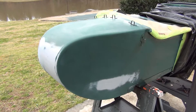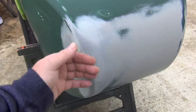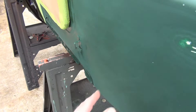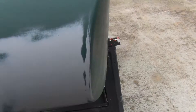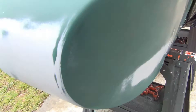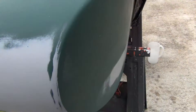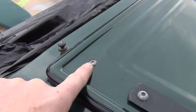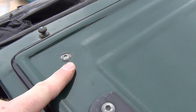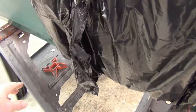We're working on painting up the sidecar — the dent has been repaired, it's all primed and ready to go. We've smoothed out a few other areas. This is not a perfect preparation; we've wet sanded it down to 400 grit. I'll wipe it down with denatured alcohol just before we paint. There's still a scratch here where you can see telegraphing through, but there was a huge dent here before with gouges, so I'm not going to worry about it to that extent.